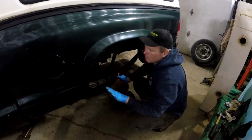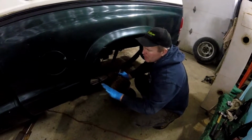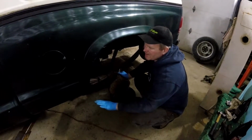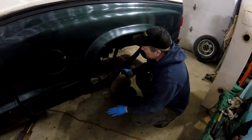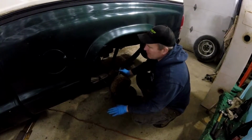The brake pedal at first might go right to the floor, but he pushes it there and holds it there anyway, because what you're doing is compressing air. Then you'll open up the nipple and let it go. You'll open this up a little bit, it'll go sput, sput, sput, and then you'll close it.